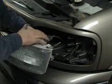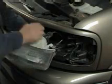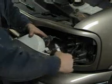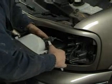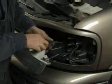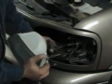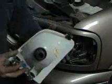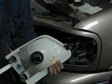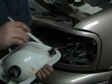And now we've got the same sort of thing here with our bulb. Just nice and gently lift on the little tabs, nice and easy. And that'll just pull right out of there, nice and gentle. And you can see here on the light, you can see the runners on each side where that slides into. It's guides. So when you put it back in, it goes through.